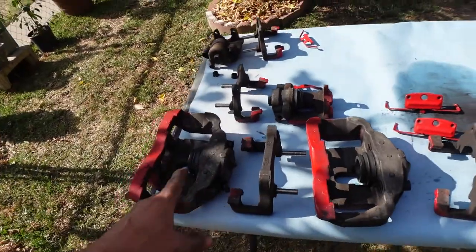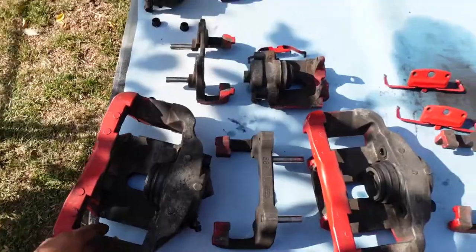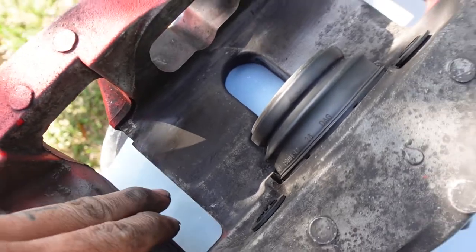So the next step for right now is I need to go through every single part. I'm gonna just sit here like an idiot and just sand everything down. I'm gonna just hit everything with Scotch Brite, and if there's like some really smooth areas like this, I might hit it with 220, but I don't think I will have to. Once everything's sanded, I need to go ahead and clean everything really good, because it needs to be 100% clean as a whistle before you paint them, or else the paint's just gonna flake right off within a week. So let me get started on sanding, and then I'm gonna clean them, and then I'll check back in and get started with the primer.